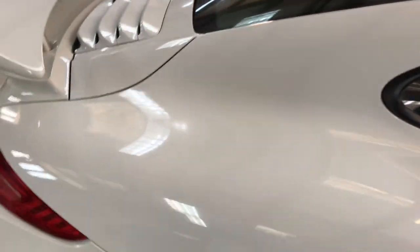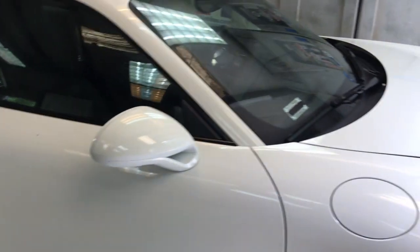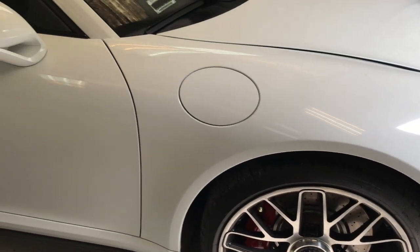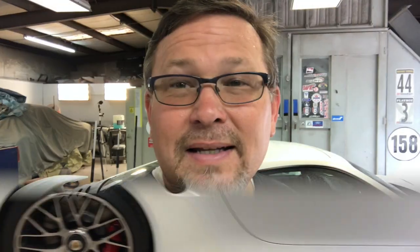It's a clear film — you can kind of see it on the glass there — that you spray on the vehicle to protect it from overspray. I masked off the front bumper since I'll be working on it. After you're finished, you wash it with water and the film turns into soap and washes off. It's an extra step on top of plastic, but sometimes overspray can get underneath plastic, so on a car this nice I always do the slime and plastic covering.